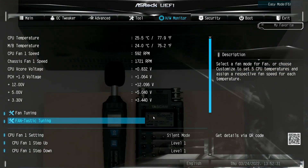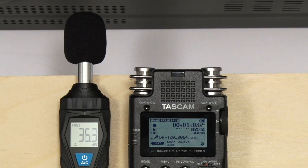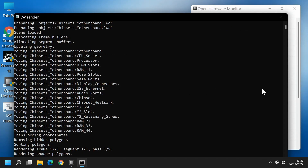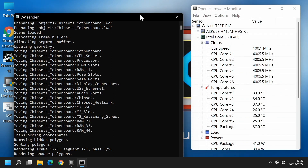Let's go across to a shot of the level meter and recorder — we're now hearing the recording made by the recorder so you can get a feel of how noisy the PC now is. The sound meter is now bouncing around at about 35 dB, rather than 42 dB at idle as we had previously. The main thing I'm very aware of now is that most of the noise coming from this computer is now coming from its power supply fan rather than from its CPU cooler. With Open Hardware Monitor running on the Windows desktop, the CPU package is at about 24 degrees with the cores clearly idling. I'll now run a Lightwave ScreamerNet rendering script to load the CPU — you can see the CPU cores have leapt up to full speed — and we'll let that run for a good 20 minutes.